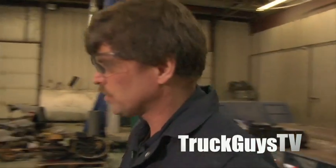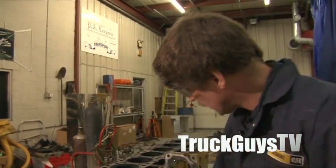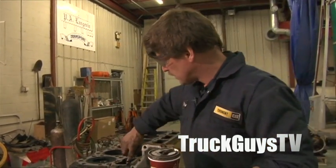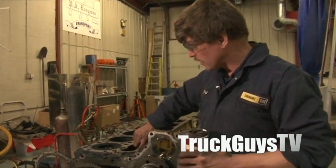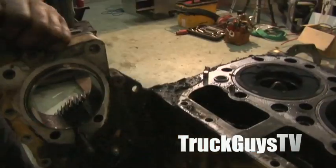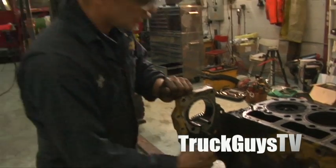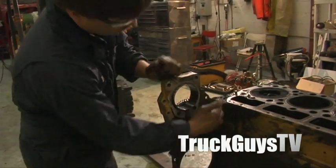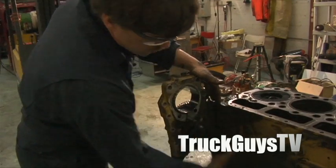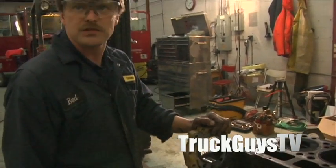What's next is I'm going to pull the accessory drive gear off and pull the idler gear off so I can take the timing gear plate off, because it's leaking. That's where the oil leak started — between this plate and the block. This gasket was leaking. Before we took it apart, I ran the engine and checked for oil leaks and it was coming down this joint right here. You can see it's all been at the highest point here — all the oil has been going down this way.